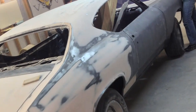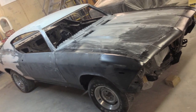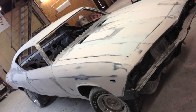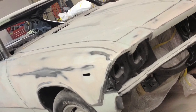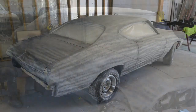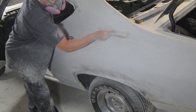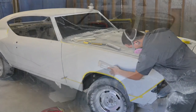This car has NOS doors and new fenders, and of course new quarter panels, but we still had to tweak everything to make it fit right. And the process was get some metal work done and then use Evercoat Quantum 1 body filler from end to end, followed by an Evercoat 4-to-1 super build sprayable polyester filler, and blocked that, and then various coats of primer and blocked all that. And eventually we got the car wet sanded and it was time to spray the color